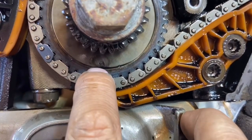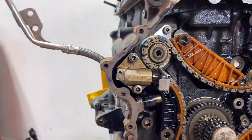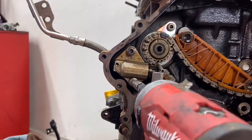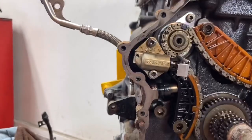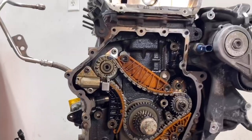This is the one that's hard to locate. You can locate it, but sometimes when you pull a pin it'll be a half tooth off or something — I'm about to show you that. So once you have the new style tensioner in, then you throw the guide rails in. I'll show you how to do that.